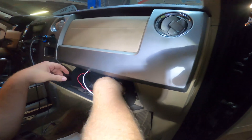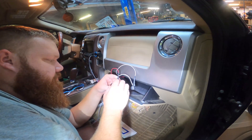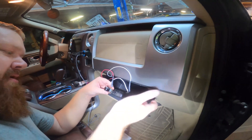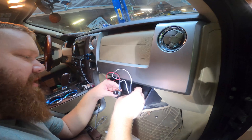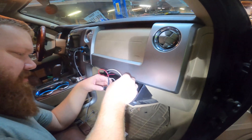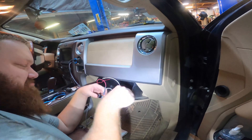The idea here for our finished install is to 3D print a bracket without having to modify the glove box at all, that will click on to this back wall and let those just sit in the glove box. So when you want to turn it on or off, you just reach in and hit the switch. Right now they could probably ride in there, but I'm a little concerned about that potentiometer bouncing with vibrations and changing. What a lot of people do is just put a little bead of hot glue in there to freeze it in place. Our whole goal here is to not modify a single thing on this truck. If you want to drill holes in the back of your glove box and mount the switches there, you can totally do that — we're just trying to do it with no modifications. I'm guessing there's a lot of people out there where maybe one day you want to sell the truck, and instead of having to explain what's going on, you can just tell the person what you did: if you don't want it, take it out; if you like it, great.